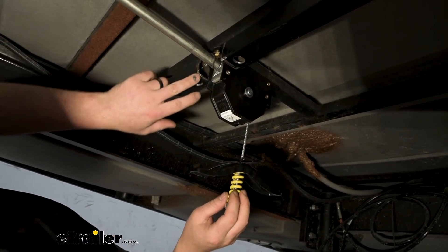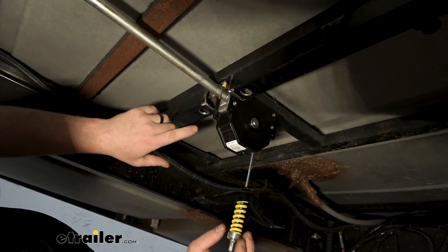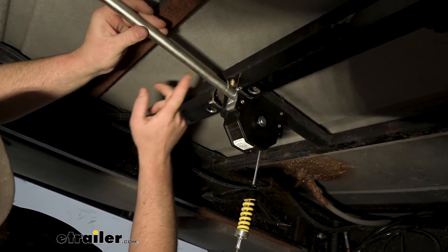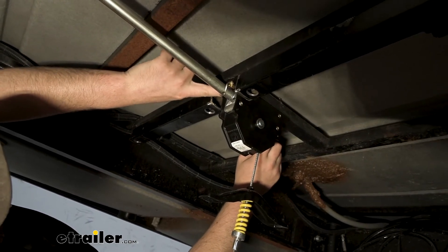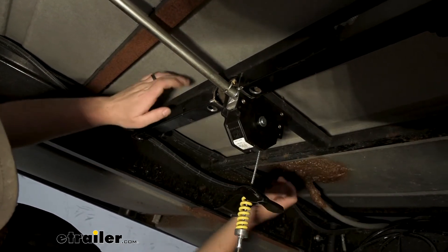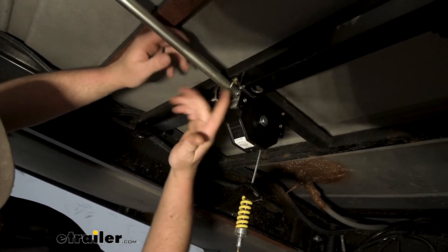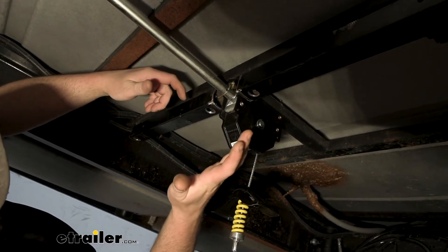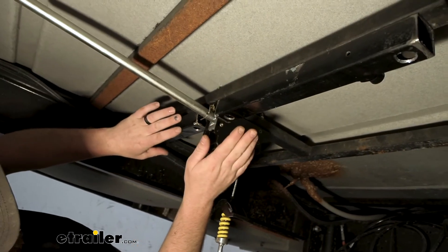Something I do want to mention that I wish was a little bit different — especially in our application — is the fact that the rod that turns it is below our mounting points. When I bolted this up, I realized that when you put the tire up, the tire would normally sit against these metal supports. But with this rod here, that's not going to work because the tire would hit it and pinch it. So I did have to change that up a little bit and put some pieces of steel here to give me the clearance I needed.